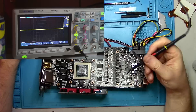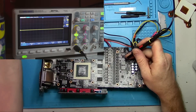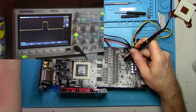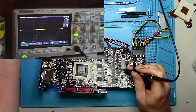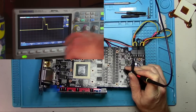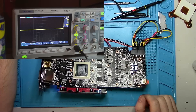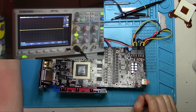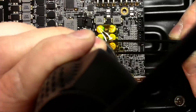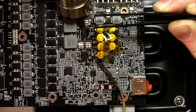And then I thought, why not do one more test with an oscilloscope and see if there are any issues. And what do you know — looking at this memory phase signal, which by the way is a perfect signal, the other phase does not look good. There are a number of potential causes for this: it could be the MOSFETs, their drivers, or any capacitors that are part of that circuit. One can only guess at this point, so I will start from the most suspicious to the least suspicious and we'll see what we find.